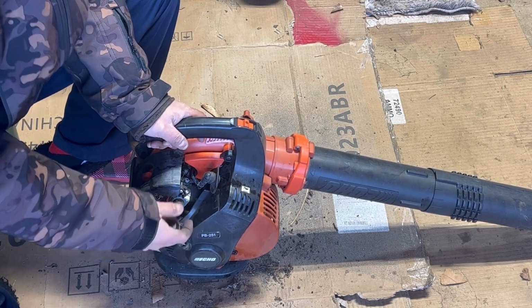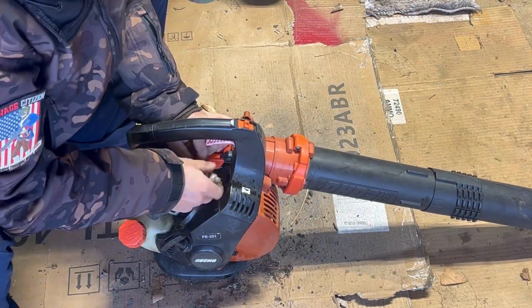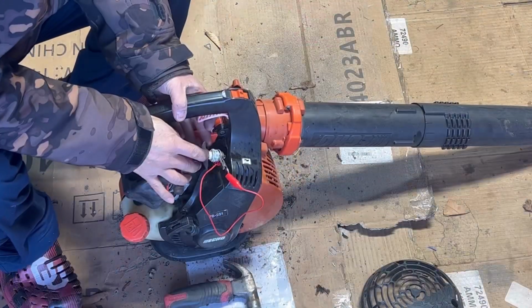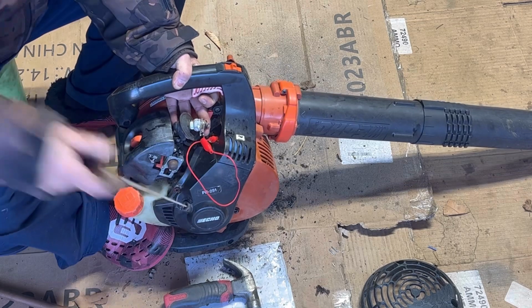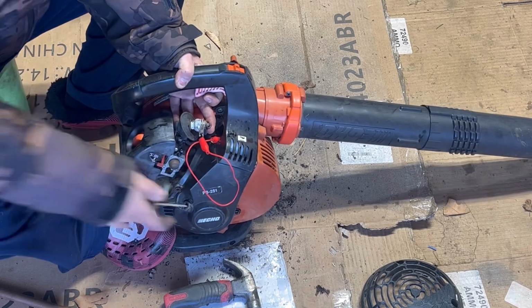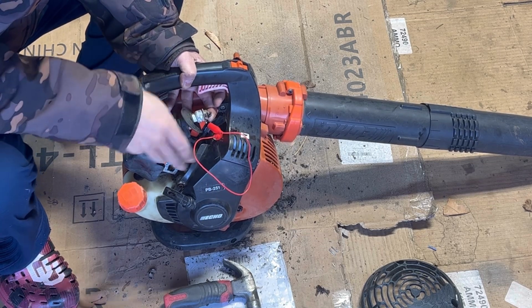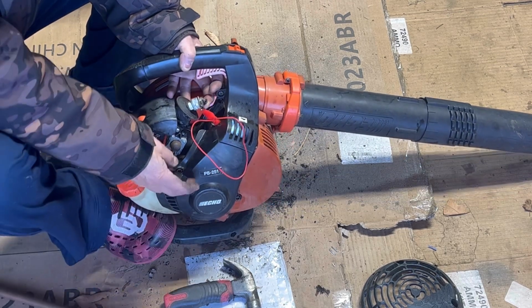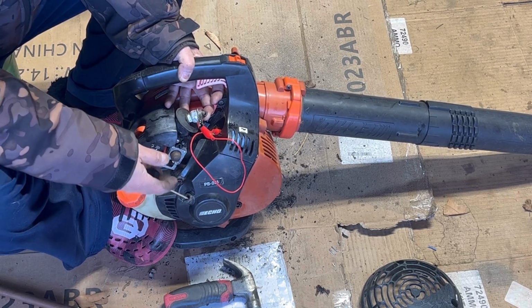Seems a little easy to pull, doesn't it? Well, I have the spark plug out, you know. Do we have any spark? I've attached the ground wire to the block and to the thing, and I'm also putting my hand on it. No spark. I feel nothing. No shock, nothing. I'm not surprised. The magneto's probably shot, given the amount of corrosion on this thing. Or the flywheel's so rusty that it's not giving it the good air gap contact to the magneto.